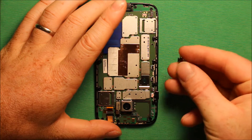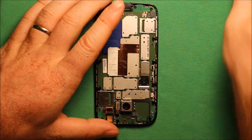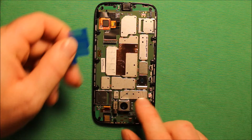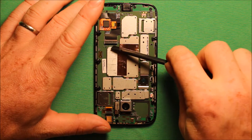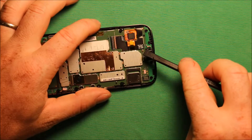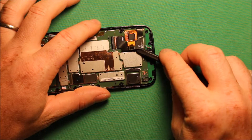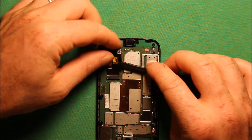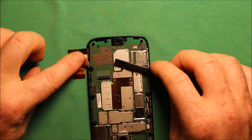Next you may as well remove the volume button and the power button — just make sure you keep track of how they are turned because they like to fall out anyway. Then remove this blue rubbery piece and set it aside. Pop up this connector right here, and then carefully get under this corner of this cable — it is just stuck on there with a little adhesive — so carefully loosen that up. This part has to come up with it as well, and then just pull this little flat connector out and bend it over.